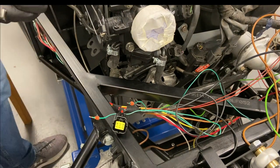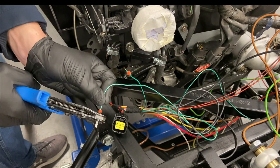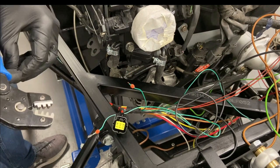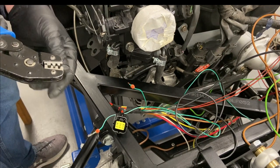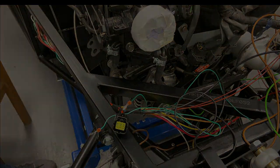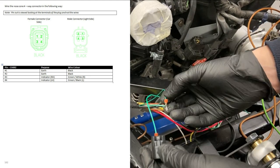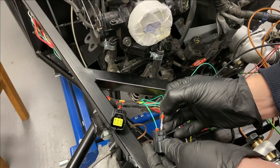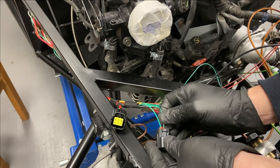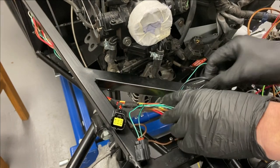I'm going quite slow at the moment, but they just crimp up so lovely - they really do. Now all I need to do is get the pin-outs. I've just put the first one in - pin 3, green-white. Pin 4, green-black. And then the other two, pins one and two, are both blacks.